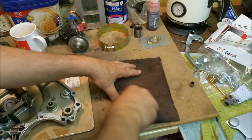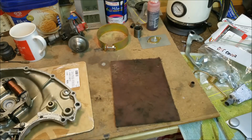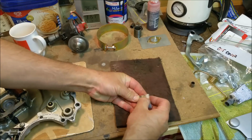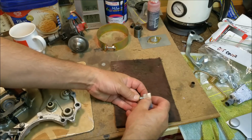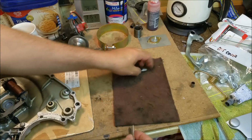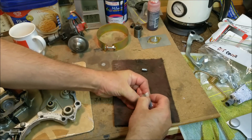It's rolling around these dowels on a bit of Scotch-Brite. This is old Scotch-Brite. You can hang on to this stuff for years, and it's $2 a piece, and you literally can't do without it because it doesn't leave fragments. It's great for places where bearings run, if you know what I mean, because it doesn't scratch, and it also doesn't leave bits of carborundum like wet and dry. Let's go around there, just get rid of some old sealer.